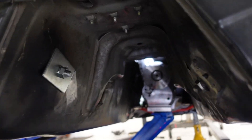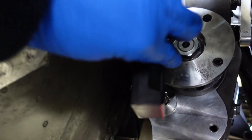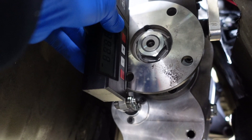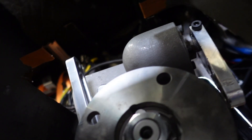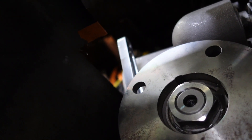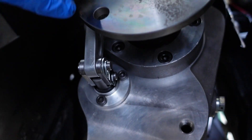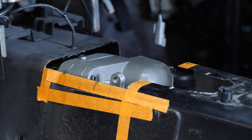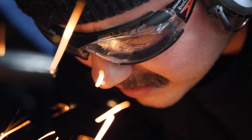Looking at the back of the transmission, it's not lined up at the moment, but we'll be using a digital level on this back face to make sure it has the same angle in this plane. By looking through the hole we just cut in the tunnel, to get this angle right we need to raise the back of the transmission. We're limited at the front by where the sump will touch the steering rack, so the only way to correct the angle is by lifting the back through the original part of the tunnel. We've just made our first set of cuts and we'll check the angle to see if we need to go further.